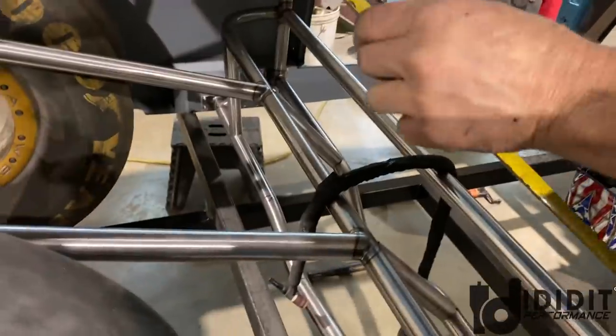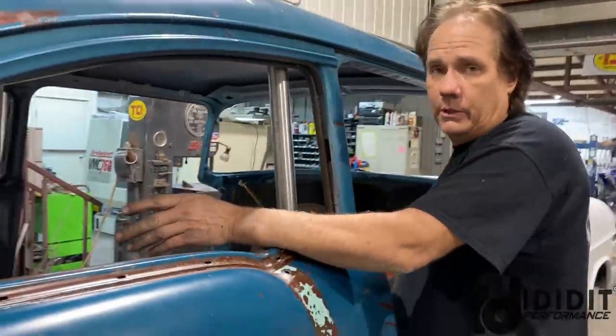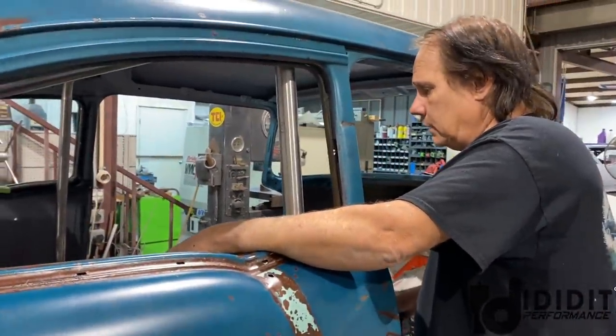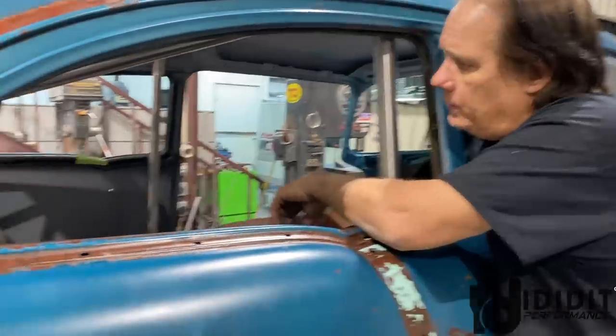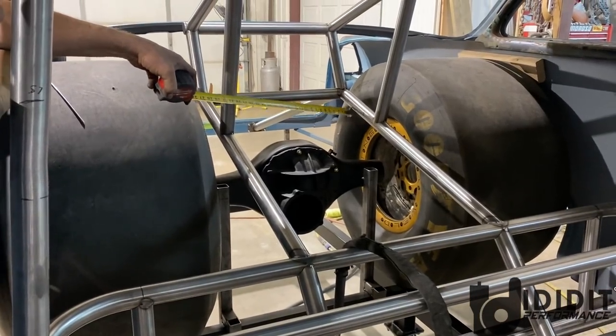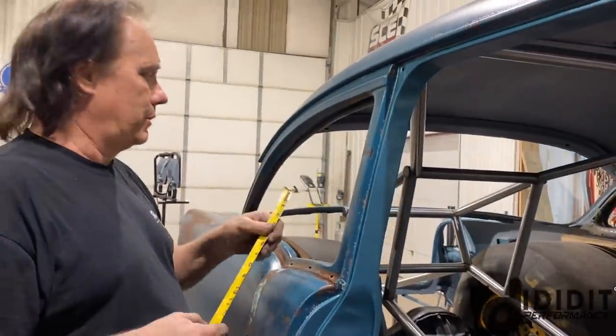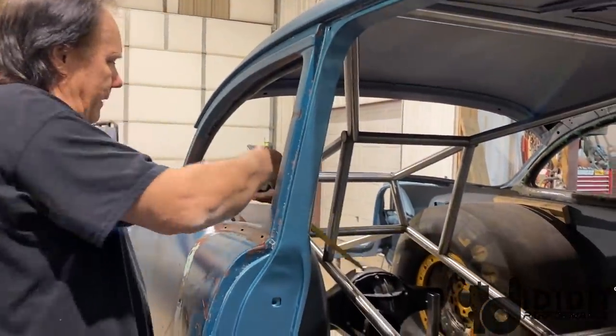This is really just a start, but they're going to come kind of like this. And the reason it's got so many bars, one, it's all there is. This is the whole structure for this kind of car. But right underneath here, there'll be a big sway bar, a 2-inch diameter splined sway bar. It'll point back and the length will go down to the rear end housing. So when you launch this car, all that twisting motion is going to be transferred into this frame.